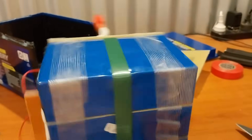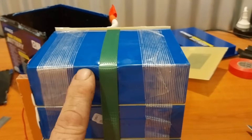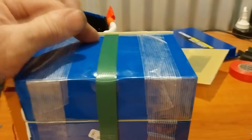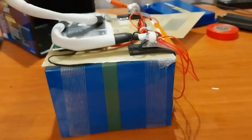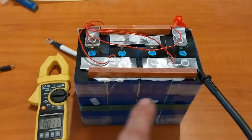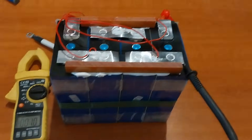I'm not sure if Kings watch my videos, but if you are: I don't know who your manufacturer is, but maybe when you do a site visit you need to make them aware that when they're strapping their cells down they're pulling them too tight and actually damaging the cells. I'm wondering if this is why the cells are bulging. The other side looks all right. So while I have the battery open, we'll test the voltage of each individual cell — we know two of the cells are damaged and swollen.